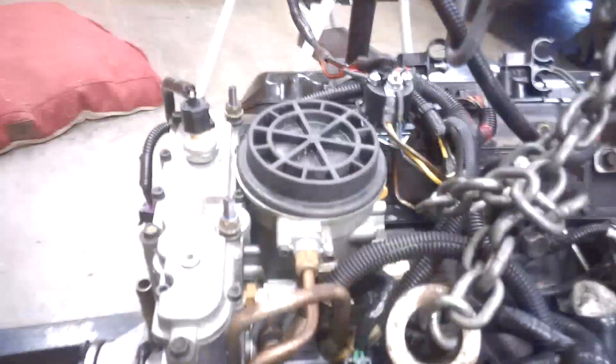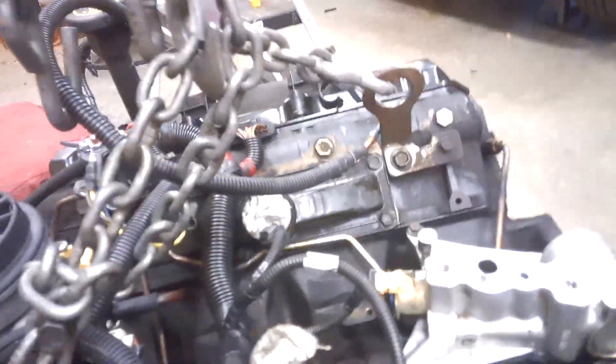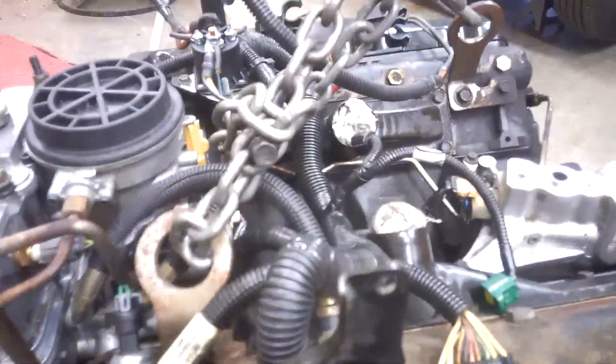Got everything all cleaned up and ready to go. He took everything apart and cleaned it all up real nice. We did also notice that when we had it apart there was some chafing going on on the wiring harness — it was rubbing on the intake tube. I'll have to look when we put it back together so I can give you a better idea of what was going on there. But it was chafing, so we put some anti-chafing on there, taped it all up real good, and make sure that's happy. We go through and dielectric grease all of these connectors.